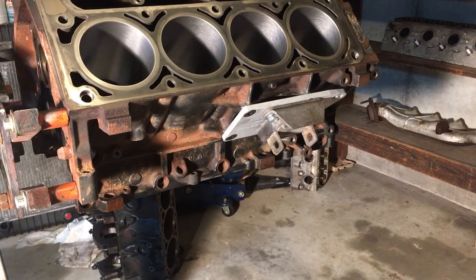I thought I'd do a surprise video — I ordered some LS adapter plates off eBay. A friend of mine, Richard, found them. They're the LSX Innovations plates, and I believe they're all CNC cut, precision cut. I'm not sure exactly how thick this is, but it's a thick aluminum plate that basically allows you to use the Chevrolet clamshell, or in my case, the Energy Suspension motor mount that bolts to the engine.